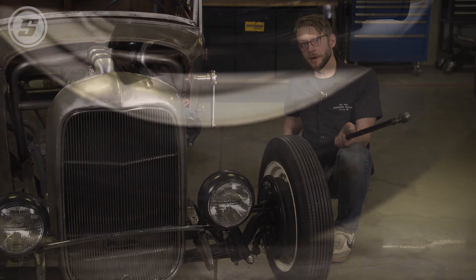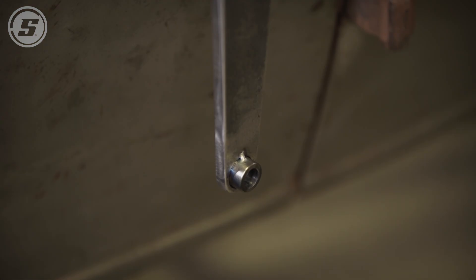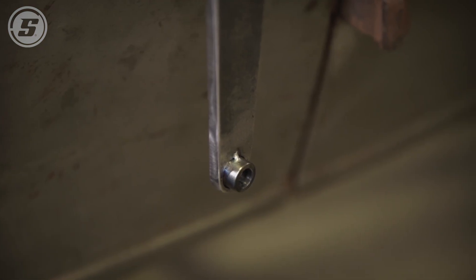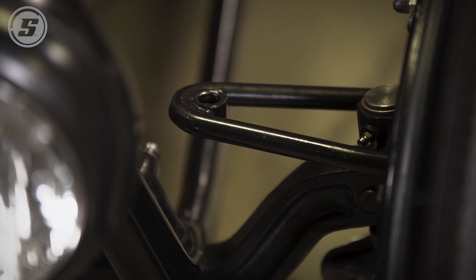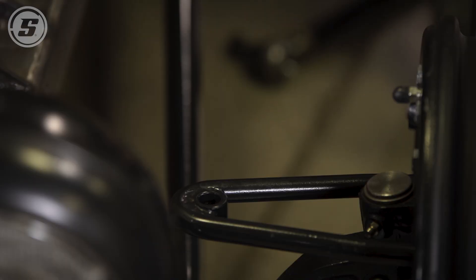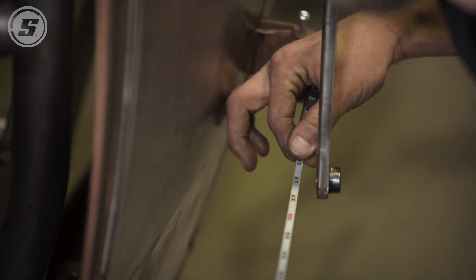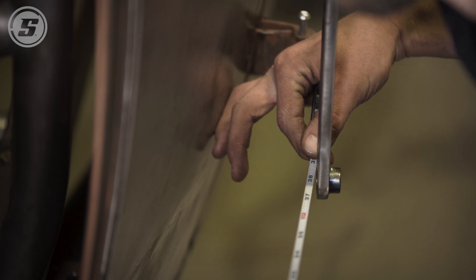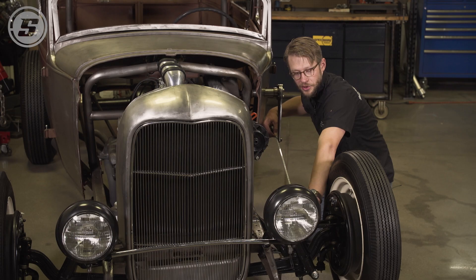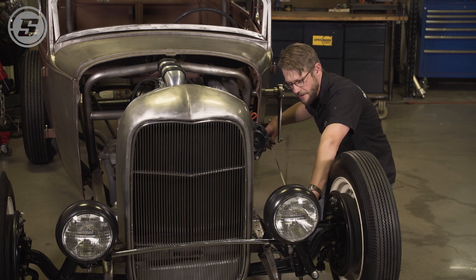Now on the drag link we're going to show you how we got there, and it's real easy to see on this car because we have a cowl steering setup — the pitman arm is hanging out for everybody to see. Here's the steering arm on the driver's side wheel. We're taking our measurement from the center of the hole in the steering arm to the center of the hole in the pitman arm for this drag link. We have the tape hooked on the back side of the hole in the steering arm and measuring to the back side of the hole in the pitman arm — a great way to get center to center without guessing. In this case we have 38 and a half inches.